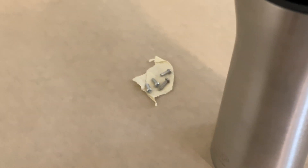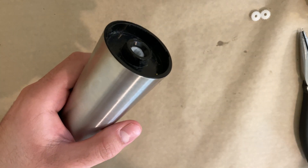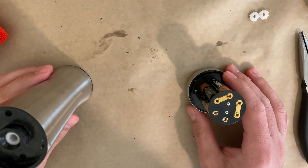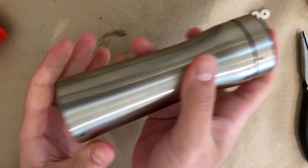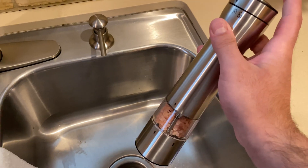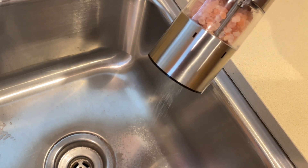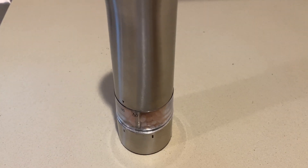Before putting anything back, make sure you put your four screws back into place. Personally I would recommend using crazy glue to bond it back, but since I don't have that, I'll use the flame again to heat up the adhesive and hold it with a microfiber towel — not with bare hands — so the adhesive contacts the stainless steel and they bond together. Once it's secured, all you have to do is put the battery back in, then turn it on. You can see how it's turning. Let's attach the salt, press the button — oh yeah, it's working beautifully! Before it wouldn't grind the salt, but now it takes these bigger chunks and grinds them into much smaller chunks. That's going to conclude my video — thank you guys so much for watching, more videos are to come and I'll see you in the next one!